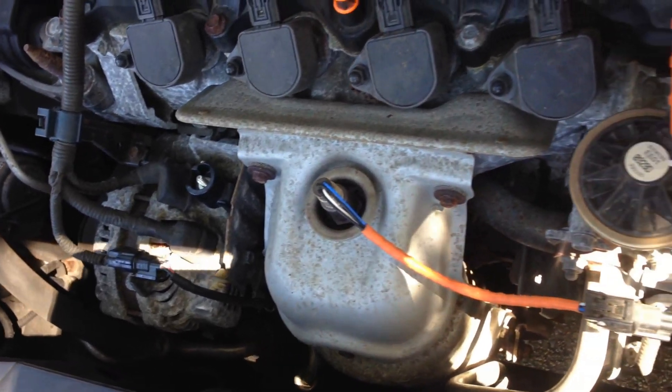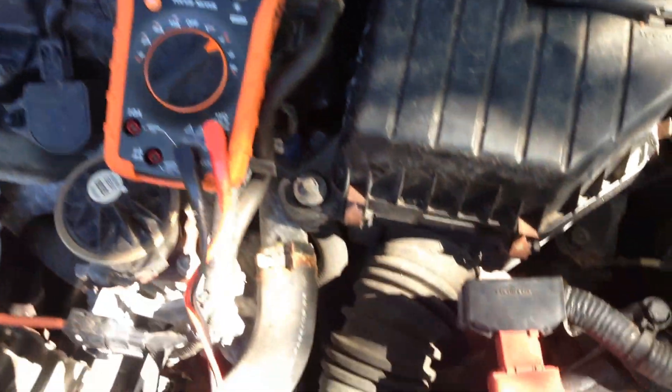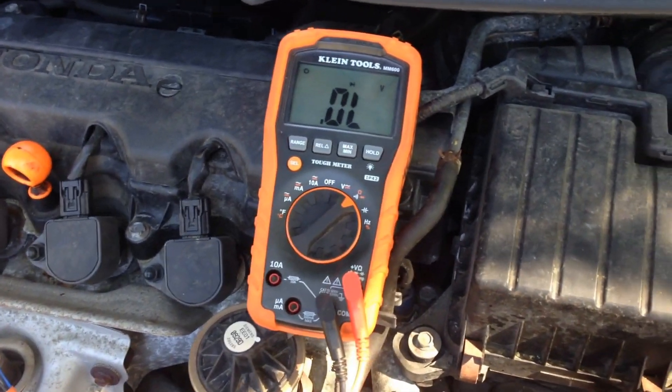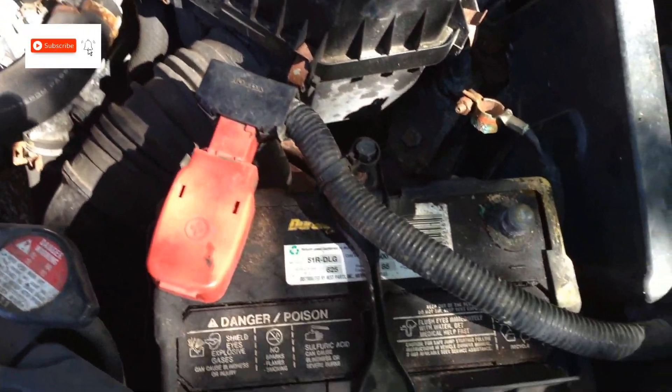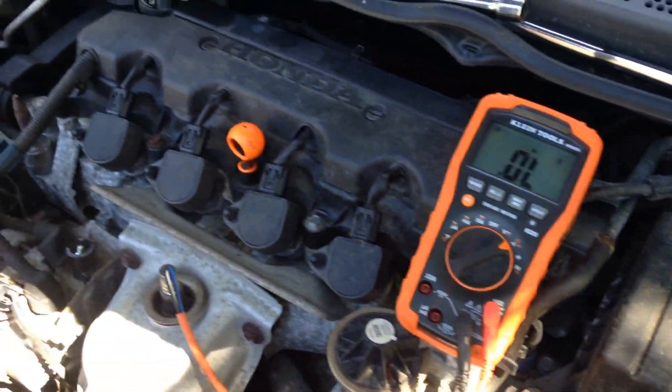So I hope this helps today. The common problems of an alternator are the charcoal connectors are worn out and the rotor has to be clean, but it must be disassembled. But this gives you a fighting chance so that you'll know — do you need an alternator or do you need a battery?